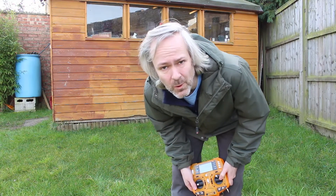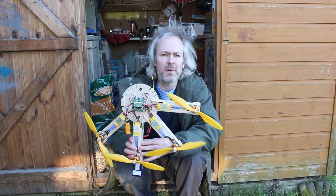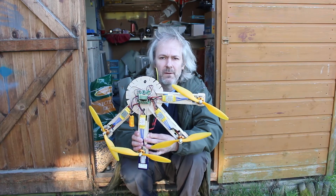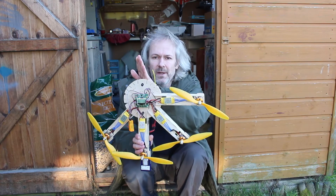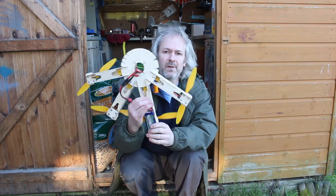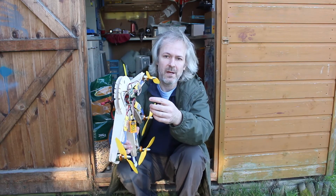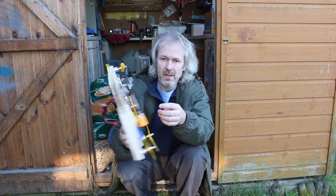I've been having a play with the quad design and tried something a bit strange — put all four arms on one side, 45 degrees apart. The front is up here, and to counteract the balance I've had to put the battery down at the other end. In theory this should fly; I've adjusted the parameters in the mixer editor to the values shown on one of the drawings, and we'll give it a go.